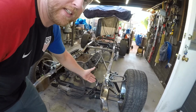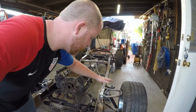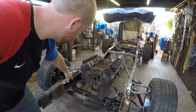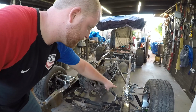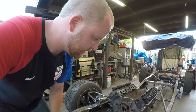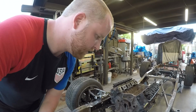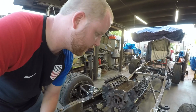The reason for that is it's basically just sheet metal, like 3/16 steel. That's a lot of weight being levered. So I need to finish boxing in this area up front, and I'm going to add some support internally, in here, with some 1/4 inch plate, nothing crazy, and then box all that in, so that way it's got some beef to the frame rail.